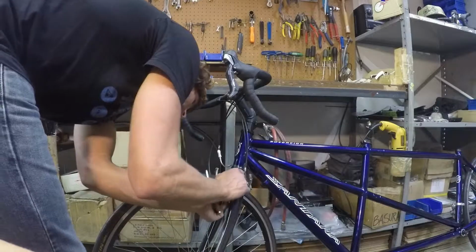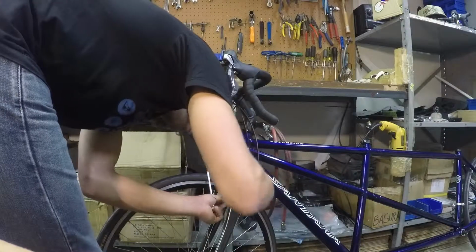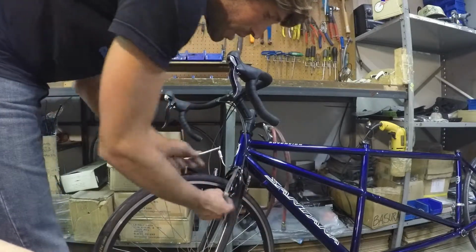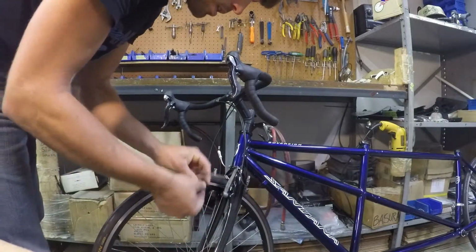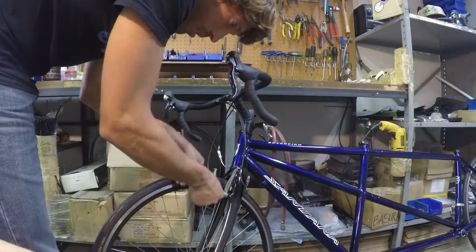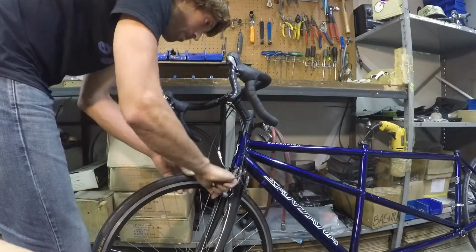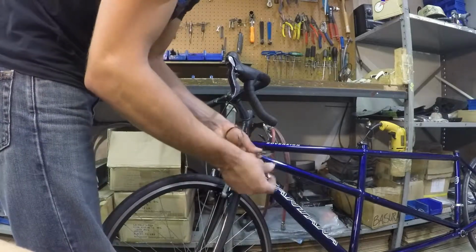You'll slide the brake onto its post, ensuring that the spring slides into the hole. This particular fork only has one hole, some have 2 or 3. Just make sure you slide the spring into the same hole that the other side's spring is in. Then use your 5mm Allen to tighten the bolt back down that holds the brake caliper on. Now we're going to uncoil and install the other cables.